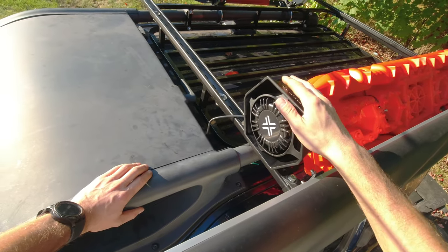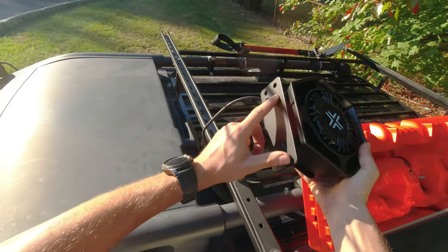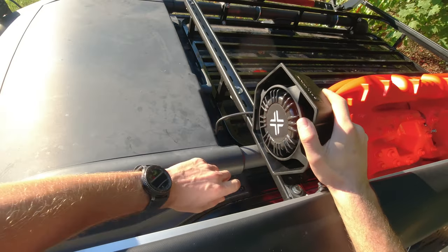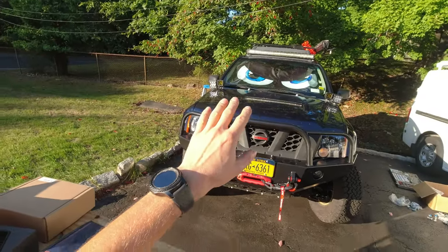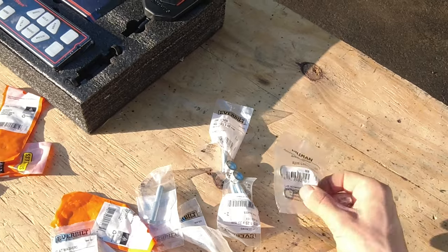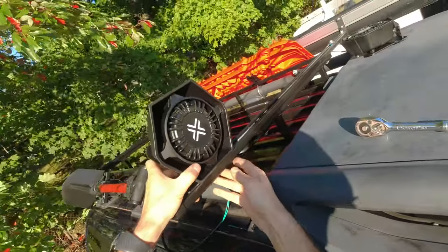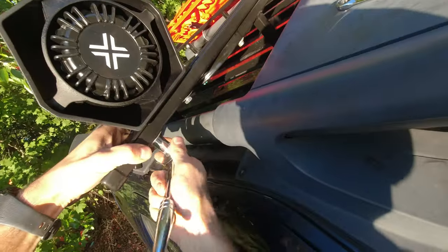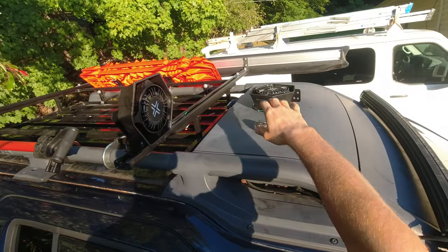My plan is to mount the two speakers up there. For one side it's gonna be pretty easy — I can just stick the screws through the holes and screw it in place. On the other side I have to drill to match the bracket position and then screw it in place. To mount the speaker on the bar, I'm planning to use M8-1.25 35mm bolts — grade 10.9 — with M8 washers. And this is in place and it's not going anywhere.